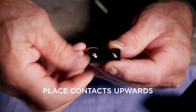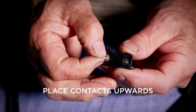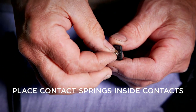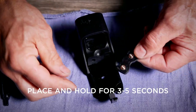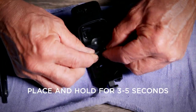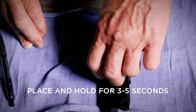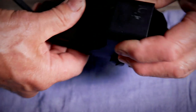The next step is to take the little nickel-plated contacts and drop them in so the cups are facing upwards towards you, and we take our two contact springs that are coated and put them inside the contact cup. We take the entire assembly and put it on the face of the sight, hold it there for several seconds, then release it and put the battery compartment on. Let that sit for a couple minutes so the adhesive will mate together, then you can remove the battery compartment, install new batteries, and test your sight for operation.